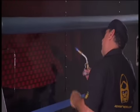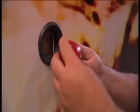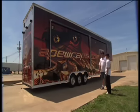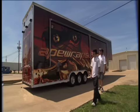Upon finishing the panel or panels, and after you've completed your rivets, relief cut the panels, heat the edges, and cut the graphic free from all the areas where you removed hardware, like the lights and receptacles. Finally, you'll give the entire trailer a good once over, completely reviewing the entire surface. There it is — the completed side of the trailer.